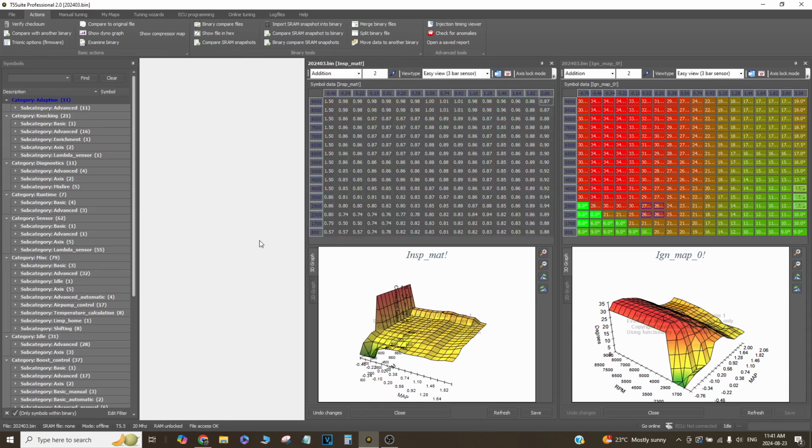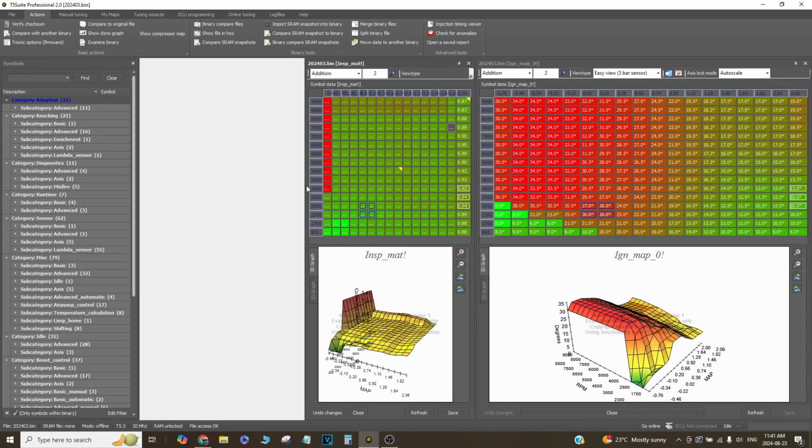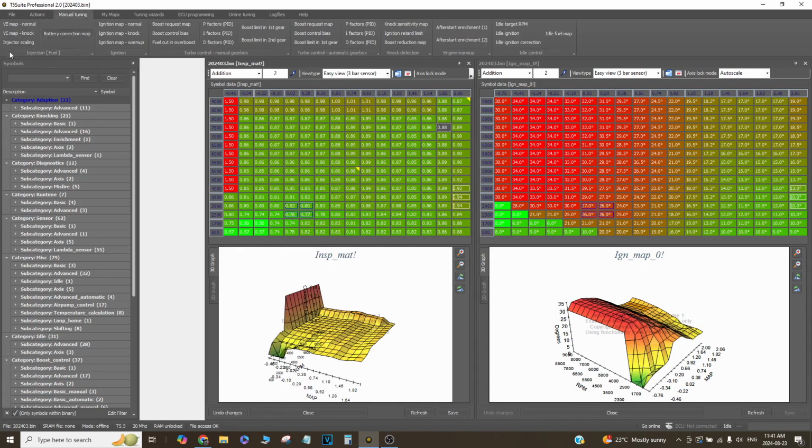So again, if all that's not crazy enough, I got more to say. The fuel map, of course, has to work in conjunction with the timing map. So let's just expand this a little bit. I have, again, no knock control. So this is the timing the car runs all the time. And even the warm-up map is identical to this map. So cold start or full bore, it's the same timing map.